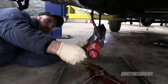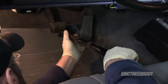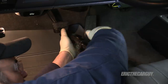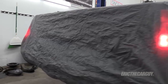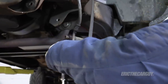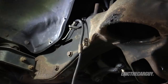That way the pressure has somewhere to go, and I'm going to do that on both sides. We just don't want the piston to come out of the caliper. Just going to depress the pedal slowly to the floor and wedge it in place — this should prevent any air from getting in the system and from it bleeding out entirely. With the brake pedal depressed, the brake lights will be on the entire time and I don't want to drain the battery. I'll take this the rest of the way out. While I'm here I'm also going to remove the brake hoses.